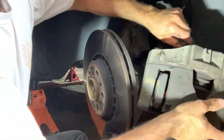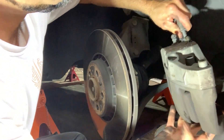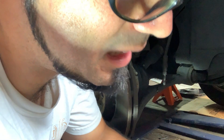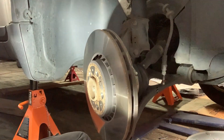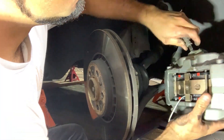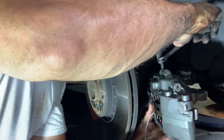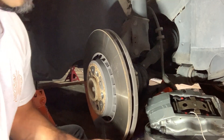This is a heavy caliper. Most of this project is research — it's not all that hard to do. My research showed the S60R and V70R use the same master cylinder as the XC90, so I don't think we'll have any issues. Once I got the caliper bolts tightened, that set the brake line angle a little better.